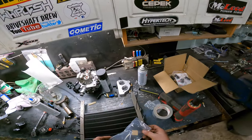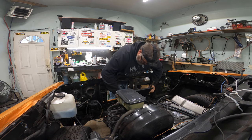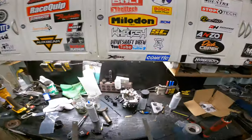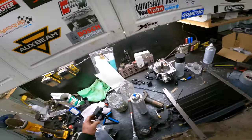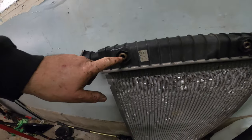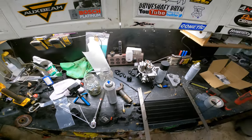I put the little spacers on each side, the little doodads on, and that's what holds the cooler in. I'm liking it because now the whole thing is uncovered and nothing's going to overheat. Let's just set this in for now and see where it's going to sit — right about there. I did decide to go through the rad with the six AN fittings. I have some pieces coming that adapts the radiator — adapters that go down and to six AN, so I should be able to have all six AN throughout the whole thing.